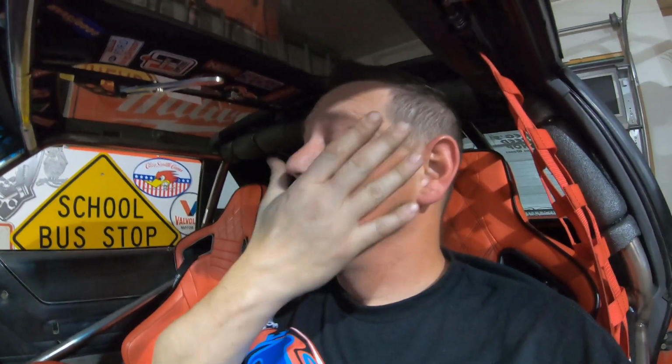Sitting here going through some of these data logs after much needed relief from the frustration of dealing with that boost control solenoid. We put the manual boost controller back on and boost instantly was there, which is what we were trying for. So really glad that's at least figured out. I've got boost, we'll be able to run a hell of a lot faster than we were last time. I'll try to work on the boost control solenoid some other time, but for right now we've got boost.